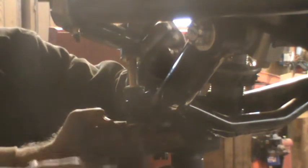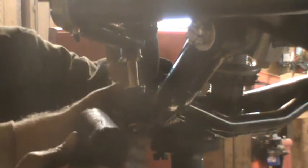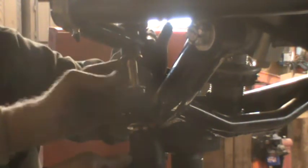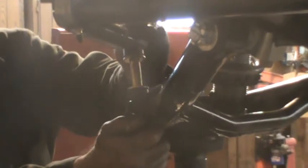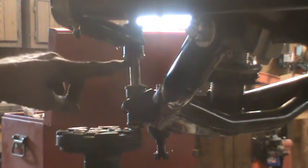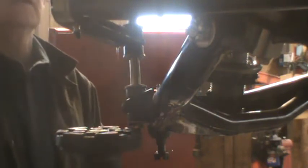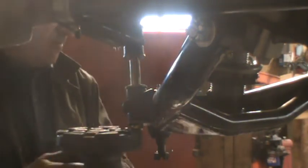This bolt is loose on the bottom. What we need is the jack under the bolt. Okay. There's play between here and here. Okay, why? You know what? Let me crawl under there and move that jack. So we got it resolved. What it turned out is that we had the shoulder edge down towards the washer, and that was that extra eighth of an inch we needed. We put the jack under it to hold the bolt up, and there was just enough to catch that.